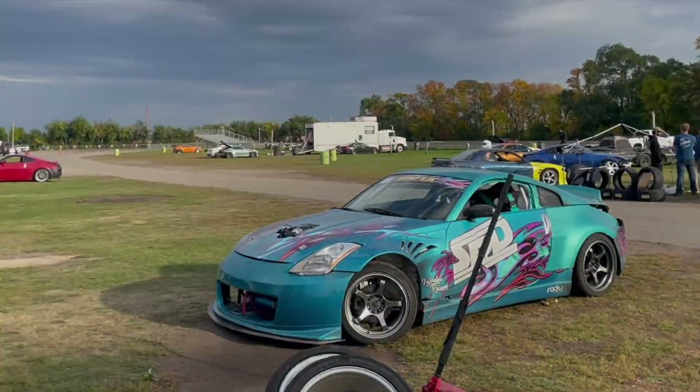I completely disconnected the Haldex controller from the top, extended those power and ground wires up into the cabin, and put a switch with a 30-amp fuse on the hot side. When I turn that switch on, the rear end actually engages. I also didn't want 12 volts running to it constantly, so I bought a pulse-width modulated controller on Amazon — basically it controls the power going to the rear end. When I want to drive, I turn it all the way up to send maximum power to that electric motor.